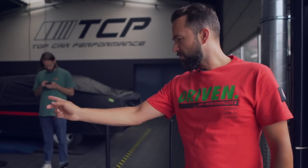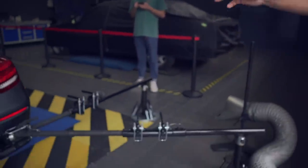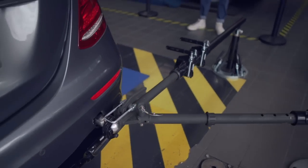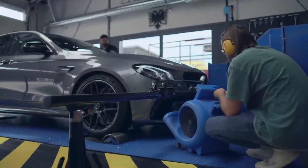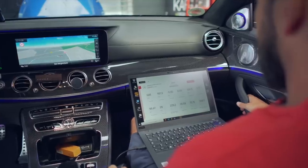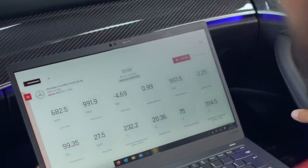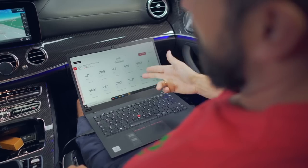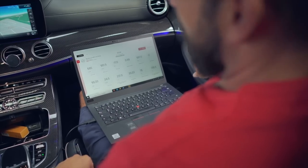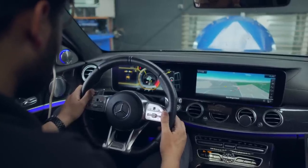Earlier it was very elaborate with the straps underneath. You saw it briefly with the Golf. This here is much cooler — ball-head mounts front and rear, solid system on top, strapped down, it works. We're measuring now, and of course we're logging along too. You sit in with me now and watch my display during the run — the logs. We're now in the vehicle and doing the baseline measurement. With the AutoTuner I have the data recording. I can see 26 values: ignition timing, knock retard, lambda value, load, everything. Afterwards we'll look at it all and see how much power comes out — then we'll put the software on.